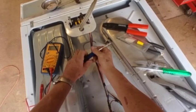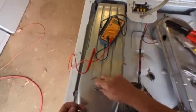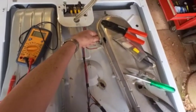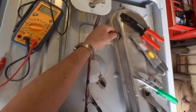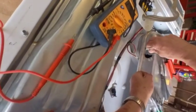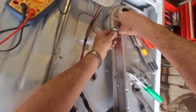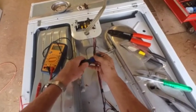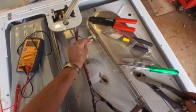That thermal fuse is the only thing that kept the man from burning his house down. It blew when he directly wired the hot wire to the element. The element was bypassed from the thermostats so it couldn't go off — it came on and stayed on until it burned that thermal fuse out. I've seen some horrendous modifications in dryers that I don't know why people's houses haven't burned down. A fire marshal would take the back off a dryer and say, here's your problem — you bypassed the thermal fuse. You should always repair these machines to the original standard.